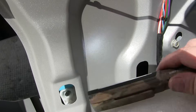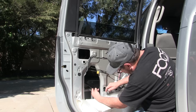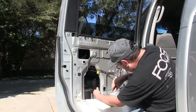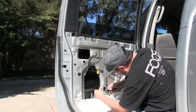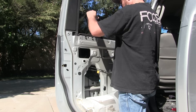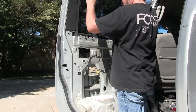There's one bolt right there and then there's one in that other hole. You may have to position the glass a little bit to align it with the bolts. Then you can get your 10 millimeter socket — it takes an extension — and remove those two bolts. Then you can raise the glass up to get it out of the way and remove the other side. There are just two bolts that hold the window on.